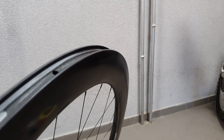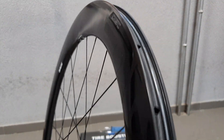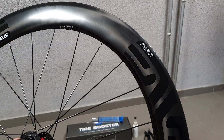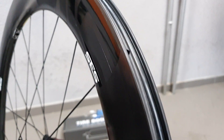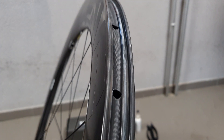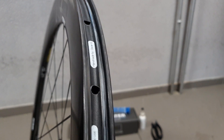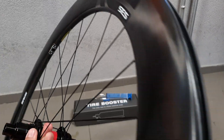Starting with the wheel — with mountain bike wheels it's quite easy, you can pretty much take any mountain bike wheel today and convert it to tubeless whether it's actually compatible or not. Because of the nature of high-pressure road bike tires, this isn't the case. As a rule of thumb, if a road wheel is not specifically designed to be tubeless compatible, it will never be safe. One notable exemption is the Hed wheels, namely the Jet, Jet Plus, and Jet Black series, which use a tubeless-ready rim also found in the Ardennes wheel line.